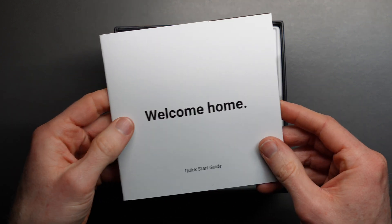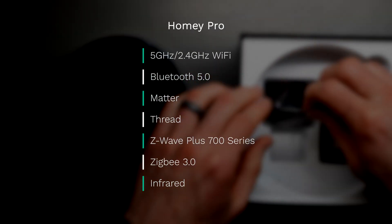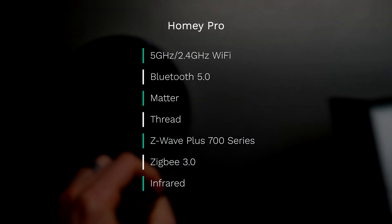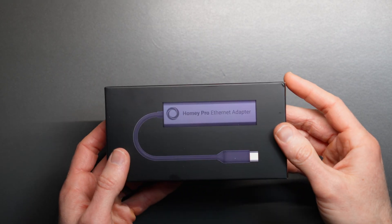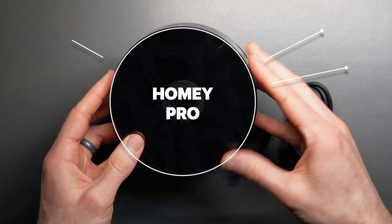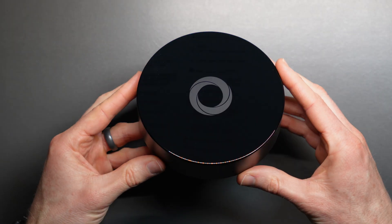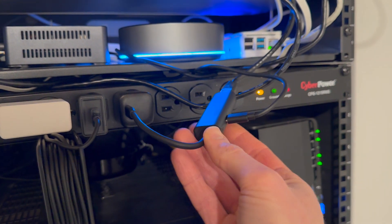To run apps and flows, you'll need a way to run Homey, and you've got a few choices. The flagship option is the Homey Pro, which is what I'm using. Homey Pro is simply the most versatile smart home hub that I have ever seen. This one device supports 5GHz and 2.4GHz Wi-Fi, Bluetooth 5.0, Matter, Thread, Z-Wave Plus 700 series (though I would have liked to see 800 series), Zigbee 3.0, and Infrared. Users outside of the US also have access to the 433MHz band. You can use an optional adapter to connect Homey Pro to Ethernet rather than Wi-Fi. Inside Homey Pro is a 1.5GHz quad-core ARM V8 CPU, 2GB of RAM, and 8GB of flash storage. The intent of Homey Pro is to unify everything into a single device without the need for additional hubs, gateways, or even a subscription. Homey Pro runs and processes your smart home requests locally for privacy and speed, and it continues to operate even when the internet is down. It can also be backed up locally and connect to local LAN devices.